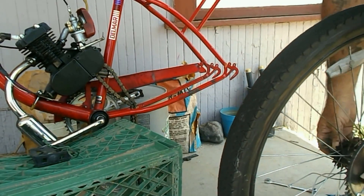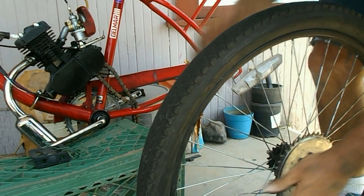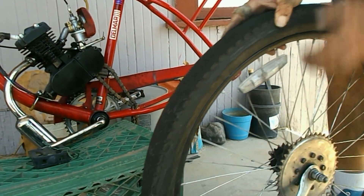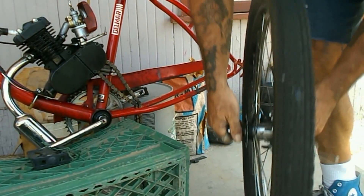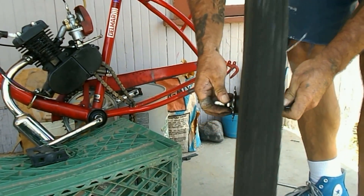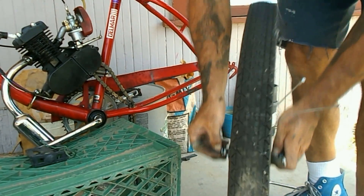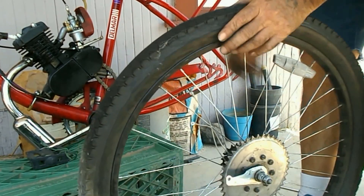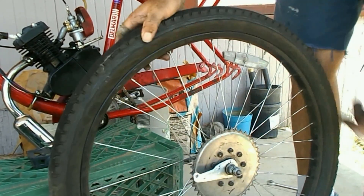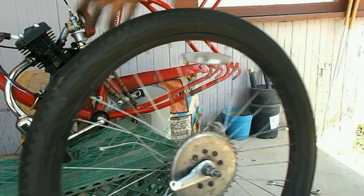I think that's why people sold the bike to the pawn shop. Look — the bearings are wobbly and we've got two spokes out. The rim is seriously bent — look at that. So this wheel is basically scrap. The next step is to take off the gear, pull the tire and tube off, pitch it in the scrap bin, and wait for tomorrow to get the new one.